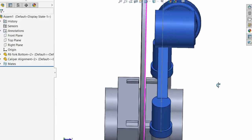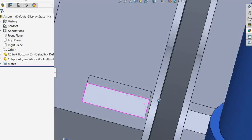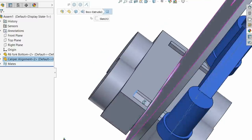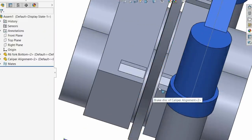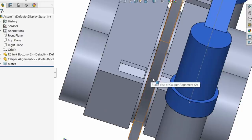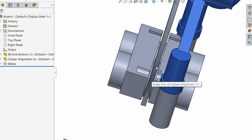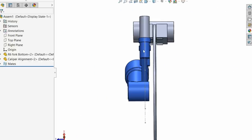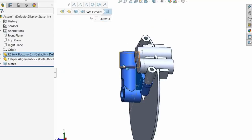Underneath, inside the bottom of the caliper, there are these profile sections that you've got to get right. If you get it wrong, remember this is all aligned: how the caliper sits to the disc, not the pads, is defined by these holes and the dowels, which is defined by this, which is defined by where the shock sits, which is defined by where the yoke goes.